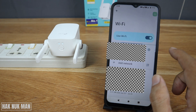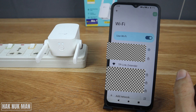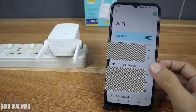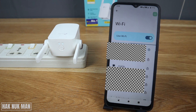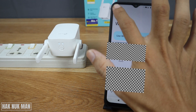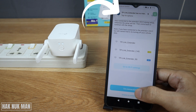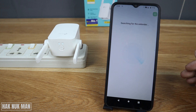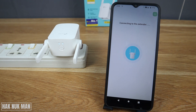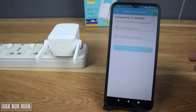Go to Wi-Fi settings. You will see the TP-Link extender listed there — select it. It will obtain the IP address. After that, wait a moment, then select 'I am connected' and it will search for the extender and connect. Now you can create your local password.